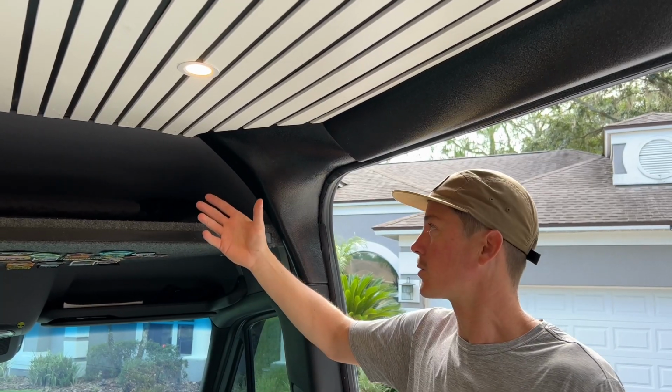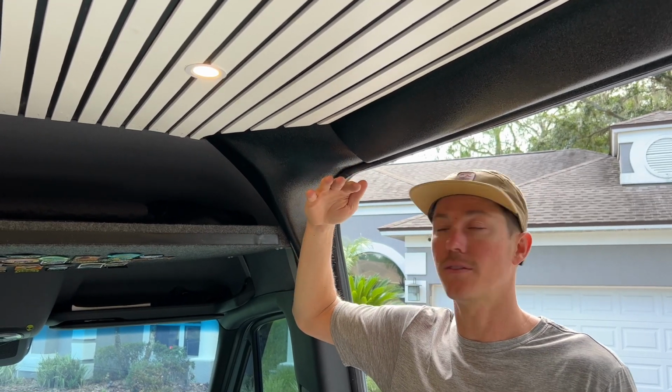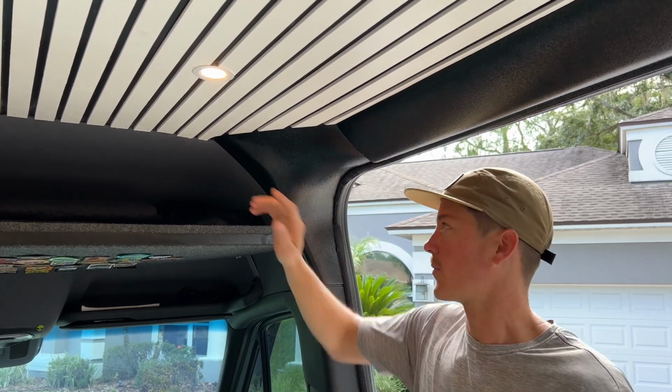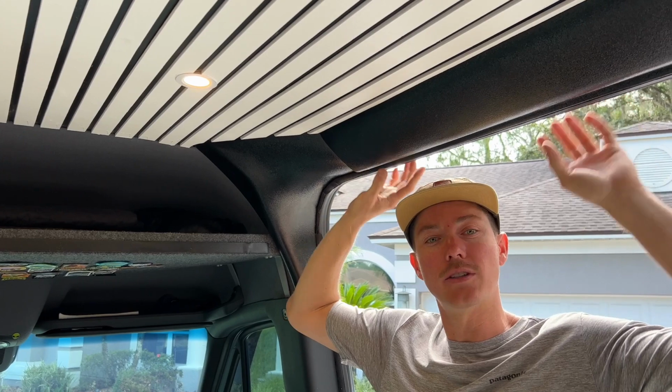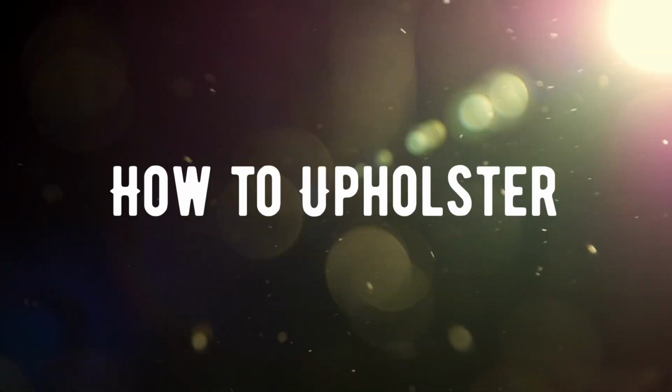These molded pieces are specifically made to go around the underside ribs on the inside of your van. And so when you put these up here, they fit snug right over top. You have to put one self-tapping screw up here, and the rest is held in with the weather stripping that comes on your van. So everything is super clean, very easy to install.